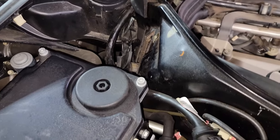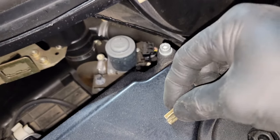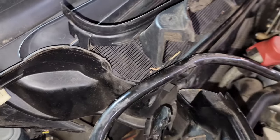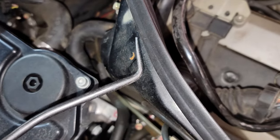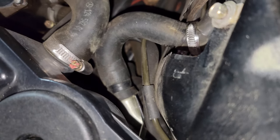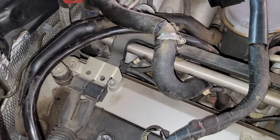If you pull up the rubber seal on this channel, there's a small metal clip right here that holds this piece on. Once you remove that, you can pull straight up. This is one of those times when it helps to have a long pick — you don't want one too sharp, kind of blunted at the end. When a hose is stuck to the aluminum line, you get it in there, work it around, and once unstuck it's easy to remove. Then the hose just gets pulled through and tucked aside.